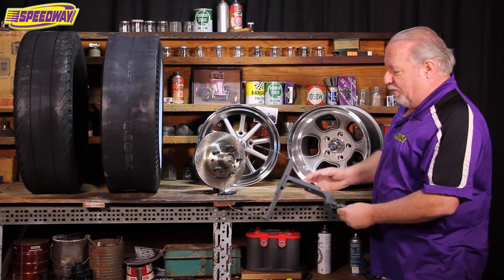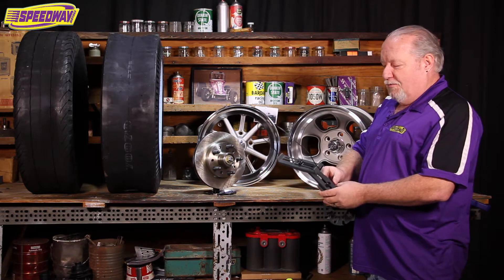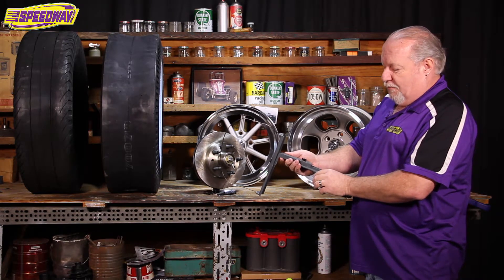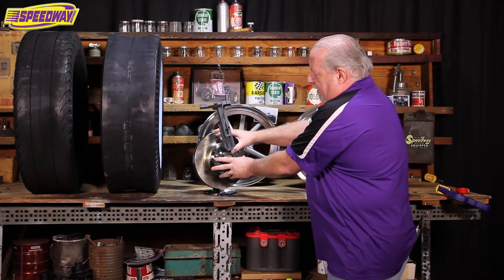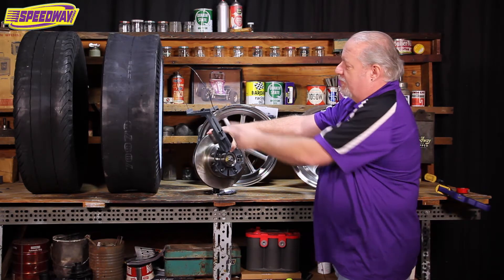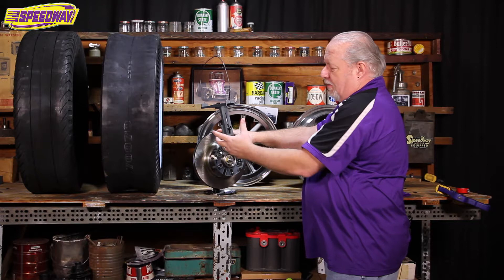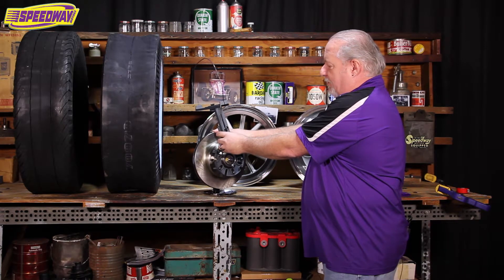The first item I brought here is our Percy's Wheelwright. This is a really handy tool for measuring what size tires and wheels will fit up underneath your car. It has an adjustment here where you can measure for your section width of your tire, and also an adjustment here where you measure for the diameter of your wheels. This just slides over your lug nuts, and while that rear end is underneath your car or you're measuring the front end, you can set your adjustments where they need to be. You can rotate it around 360 degrees to make sure you don't have any clearance issues. On the front you can also turn your wheels left and right at full lock to make sure you don't have any issues with anything hitting suspension or inner fender wells.